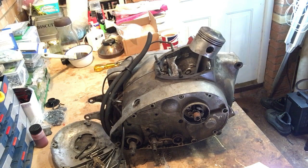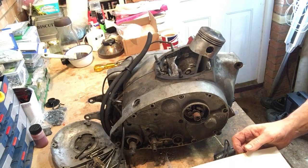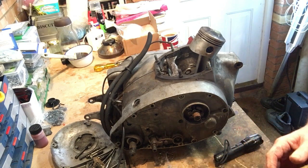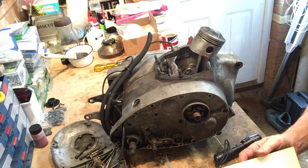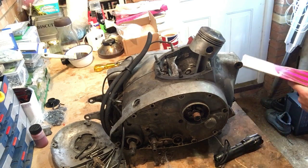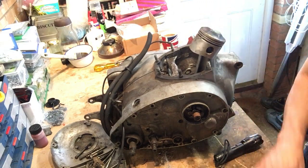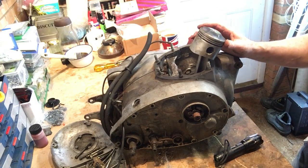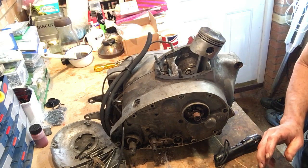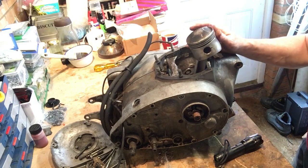And there are some 71/26 part numbers on this page. Can't be the A65, can they? No, they're 6/8. Okay. But anyway, I've heard of some anomaly regarding the fact that there might be a different part number between the piston itself and pistons that come complete with rings, gudgeon pin and circlips, etc. But anyway, we can measure those up with verniers, etc. to check all that out and compare it with the standard pistons that I've got.